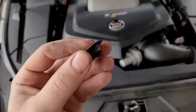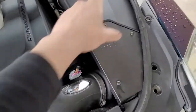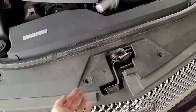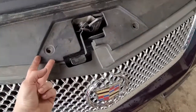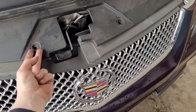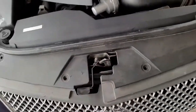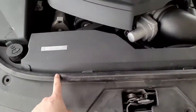As you can tell, I went ahead and got all of them out. Keep in mind these are just little plugs — you can take a flathead or a plastic trim remover. One thing to note on the twist clips though: don't pull it by the head. Try to get a panel clip remover or flathead up under it so you don't pull the center piece out. Luckily I didn't pull any out, but just a little heads up.